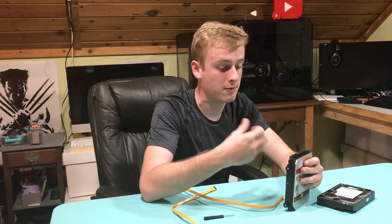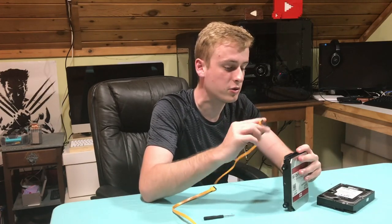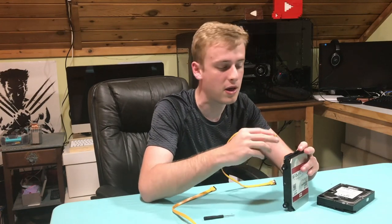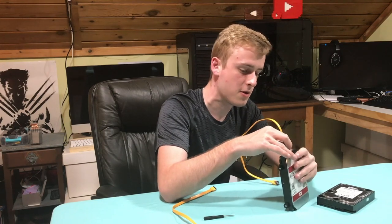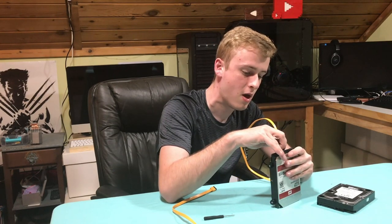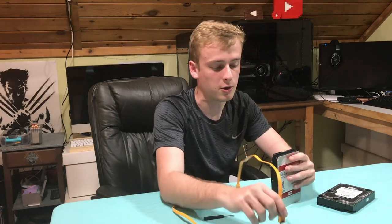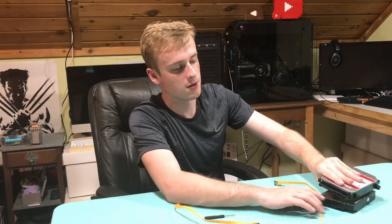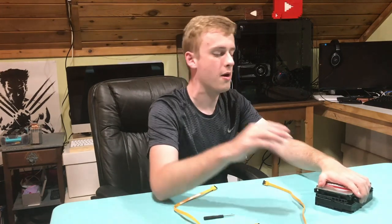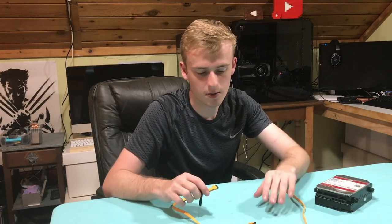This will just give you the opportunity to get more data off, and you can try something else. I know a couple of other methods that really risk losing all your data if you try them, so this is a good first opportunity to try. And honestly, it wasn't that difficult — just had to be a little careful when taking the screwdriver to right above the connector ports. I have a computer modding channel — that's what I mostly do.